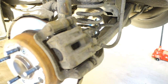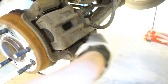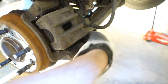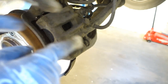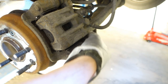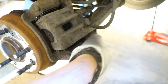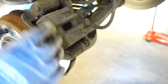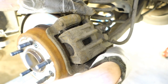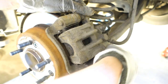Okay, and then I take this low bolt also away, and then use gloves because these are dirty, and do not inhale this dust and sand in here because this is harmful. Brake pads can include asbestos, and do not use any compressed air in that area, remember. This is only water, we can add water in here.